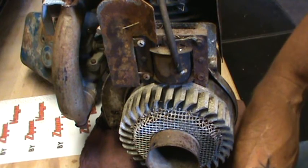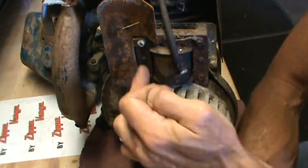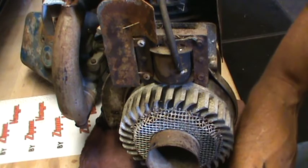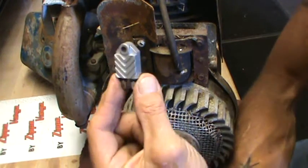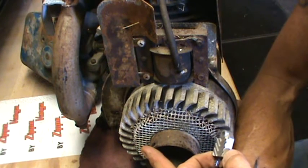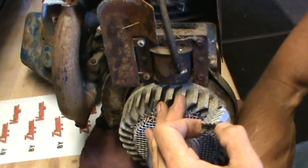What I wanted to talk about was: people have asked, can you convert these three-leg coils to electronic ignition and do away with the points? The answer to that is a resounding yes, you can — with the Nova 2. Even with the points underneath the flywheel, you can still do it. You don't even have to take the flywheel off.